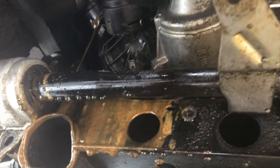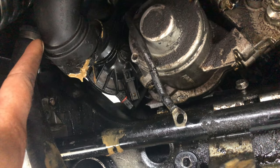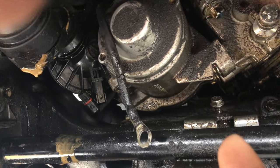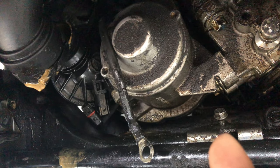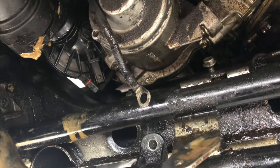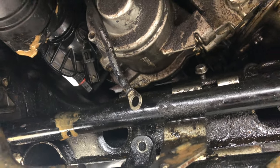It's a lot of oil in the coolant — that's nasty. I moved both hoses, so they're removed off the thermostat. This thing is pretty much still leaking out oil, looking like peanut butter. I also used a 10 millimeter ratcheting wrench and took off the bolt right here — it's attached to this bracket right here. So once I remove it, it'll allow the front sway bar to hang down more to get room.